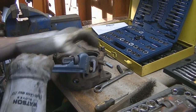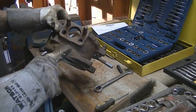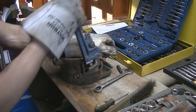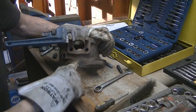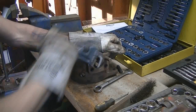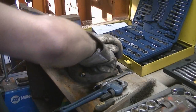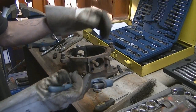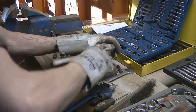If I do plan on using these knuckles, I'm gonna do the fifth stud mod. You gotta drill a hole and weld a piece of angle iron to your high steer arm on both knuckles, then drill a hole through the angle iron and run a bolt with a nut in the back. One guy is selling that as a kit — I think it's 10 to 20 bucks. But all it is is a piece of angle iron with a hole in it and a bolt with a nut. Incredibly easy to make your own. Hell, I could make that kit.